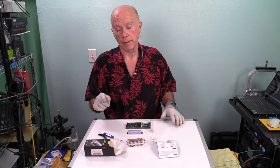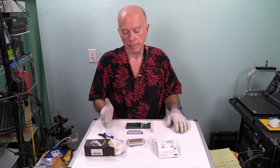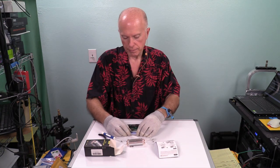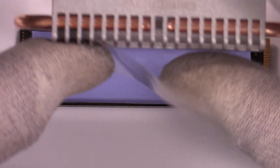That will require cutting because of the size, but it's about the thermal conductivity rating, and I'll get into that in the summation. Okay, we've got the first part of the sandwich. Let's see how this looks. Memory's in. Turn that back around. Pads are intact. Heatsink is going to go on, and remember we have to line up the top with the bottom.